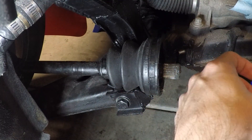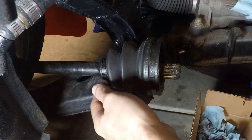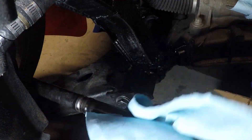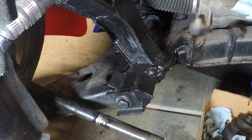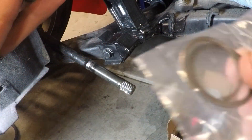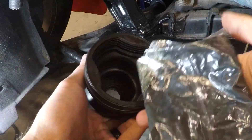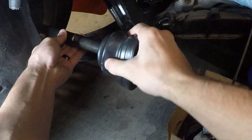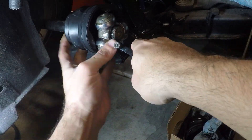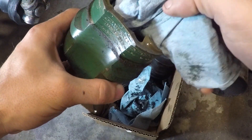If you're going to do the inside joint on this vehicle and many other vehicles, since your outer wheel has a lot more flexibility, go ahead and do both sides of it because you're going to have to take this all off again if you want to do the outside joint. Make sure that you're not making more work for yourselves and having to do the same thing twice. On the driver's side, we did end up having to replace both — we replaced the inside one because it was cracking, and then the outer joint ended up tearing as well, shooting grease all over the inside of the wheel and the brakes. So we ended up having to do quite a lot more rework on that, which is a little frustrating.